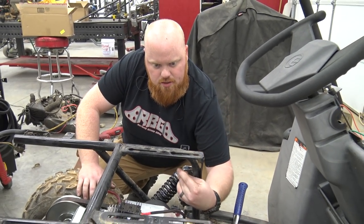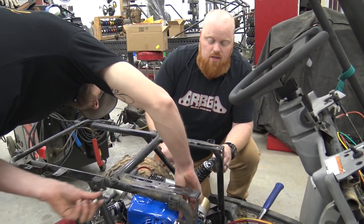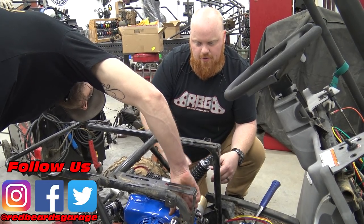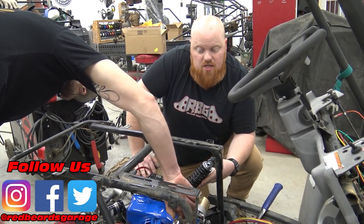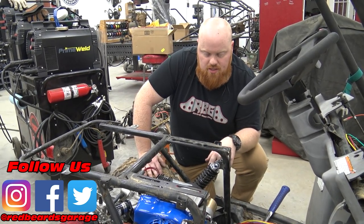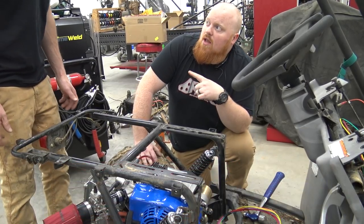Like we said earlier, we were using MB200 stock shocks. That's a Go Power Sports full suspension mini bike — we had a pair of their original shocks and they were just too weak. These are 150 front shocks for a GY6 150 go-kart from Go Power Sports and they're perfect for Grayson and Lonnie's weight.